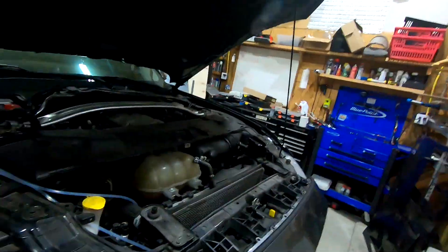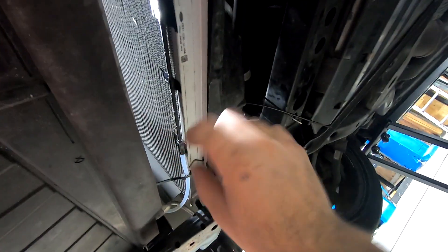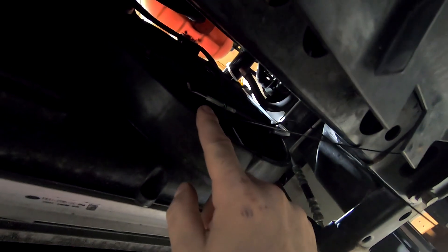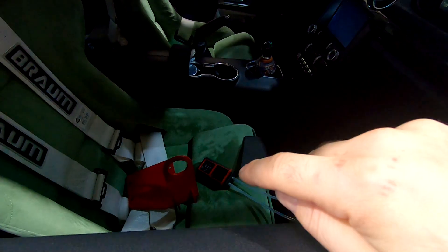So this part should be a win-win, but rather than me just telling you, you can see we've got these tubes right here which go to a pressure probe on the front — about eight inches long or so, so we can get kind of an average area. That'll be the high-pressure side on the front, low-pressure side right here — kind of the same thing. Those tubes come all the way up inside the car to a manometer that I'm going to look at while I'm driving. At the end of the video we'll do all the math and see how much additional effective cooling you'll get.